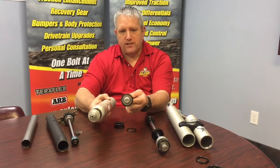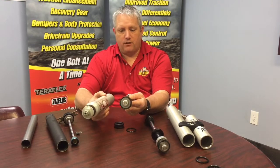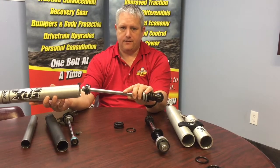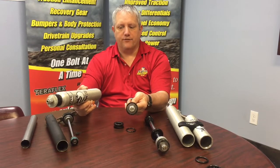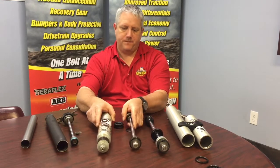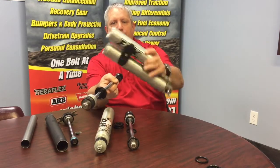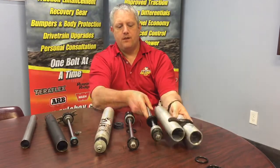So that's pretty much all I've got on shocks today. We've got the twin tube — oil and gas mixed together with a charge to help control aeration, but when you move it too fast it aerates the oil and you lose shock dampening ability. The monotube shock separates the oil and gas charge — more control, more shock in less size, tires on the ground more often, and stability in turning. Then we've got our reservoir shock, just like the monotube except with more room for more oil and nitrogen — runs cooler, lasts longer. Again this is Scott at Axelboy, thanks for joining me for a little bit of shock talk.